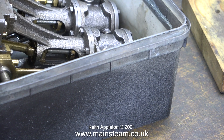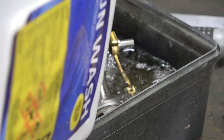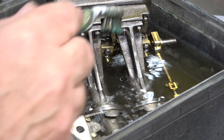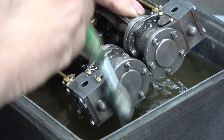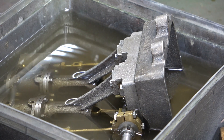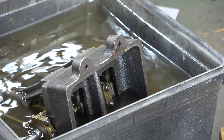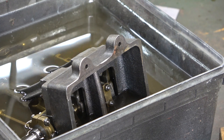I need to degrease the engine, so I put it in a polythene tub and pour gun wash all over it — that's lacquer thinner or cellulose thinners. Trying really hard not to put my fingers in the gun wash, I'm using a paint brush to persuade it to go into all the nooks and crannies of the engine. I left it for 24 hours. The inner part of the workshop with the door shut is not a good place to do this — when using powerful solvents you definitely need to work in a very well ventilated environment.